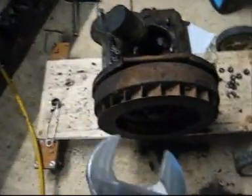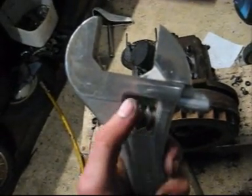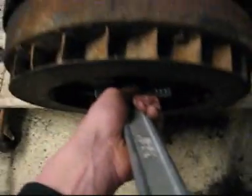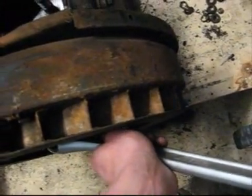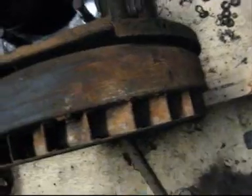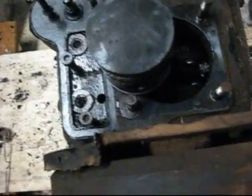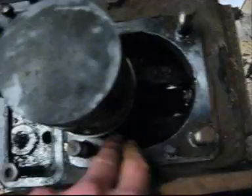I got this big spanner, but it still wasn't big enough, so I had to cut an extra groove in the movable piece to make it go large enough. What I'll probably do is get the engine spinning, and then quickly pull the spanner up the other way, and hopefully that'll loosen it. But to do that, I'm going to have to put the piston back in its bore so I'm not worried about that hitting around there.